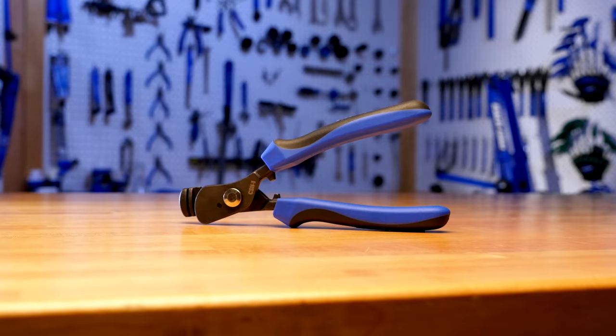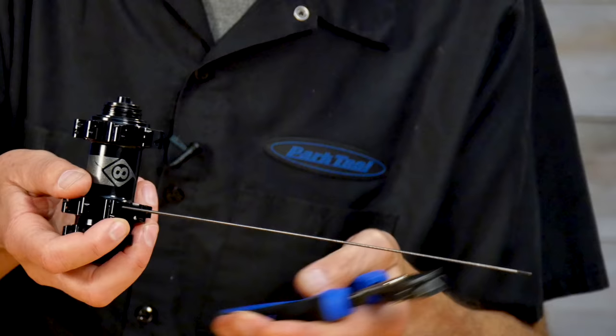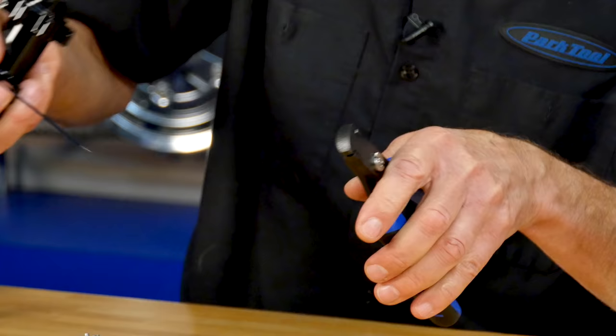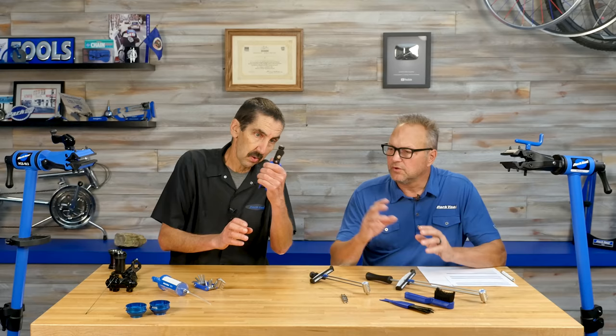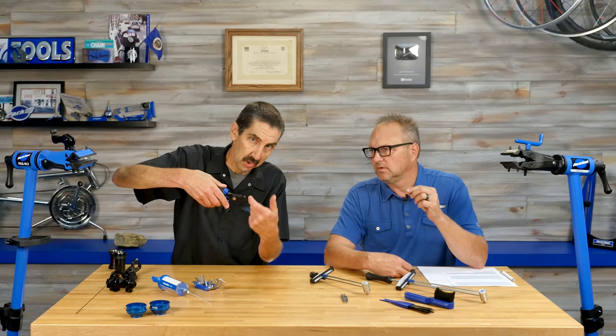This is the clamping spoke holder — a really good tool. It's going to squeeze spokes, especially straight-pull spokes, which can turn and turn. This clamps it so you can tighten the nipple down here and keep it from rotating. It clamps both this way and this way — right and left handed. Also useful on wide bladed spokes that tend to twist up. You hold it right down close to where you're turning the nipple, because when it gets tight the whole spoke will wind up. This prevents that, so you're making the nut do its job on the spoke.